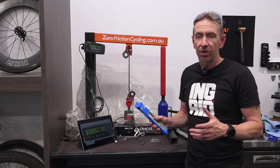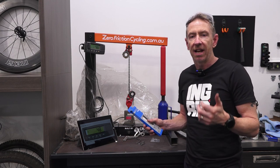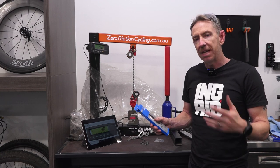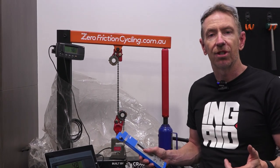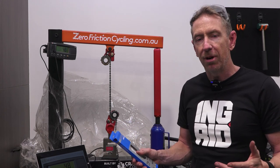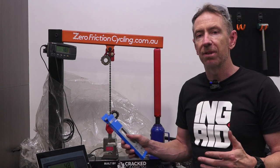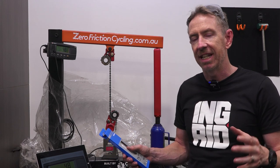Shimano chains have for a long time been my recommended chain for e-bike riders, because they have 10-11 speed, they've got okay durability in terms of wear lifespan, but most e-bike chains, believe it or not, and I've tested a few, even from YBN, which I stopped stocking for their e-bike chain due to really premature wear. Same with the KMC e-bike chain. I forget, there was another, I think it was the Wippermann. So it seems that for giving you greater pin riveting strength for your e-bike, these chains were just really not bothering giving you any sort of wear durability.